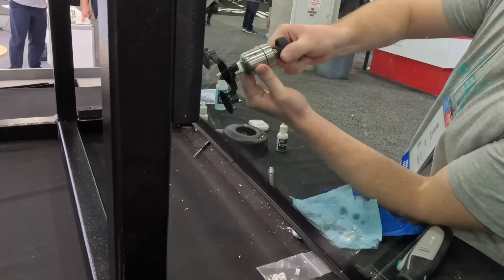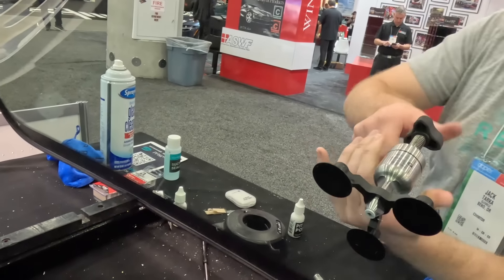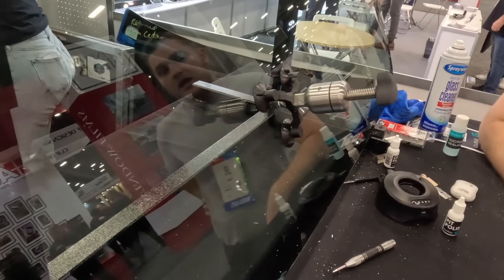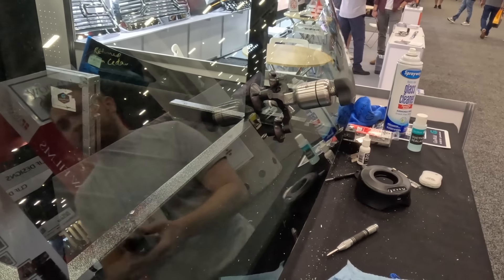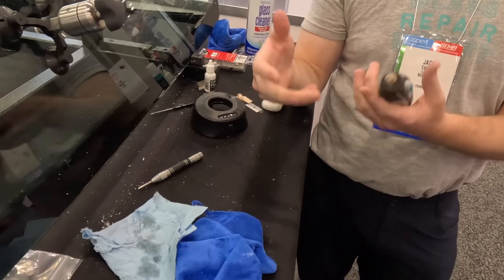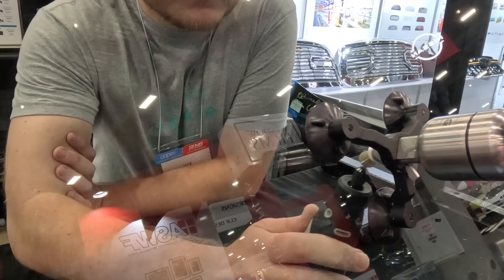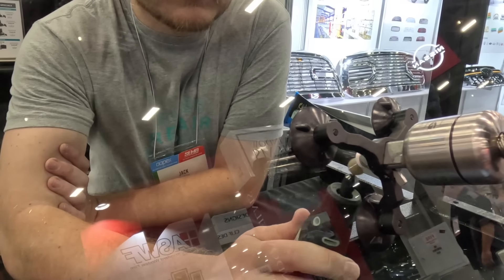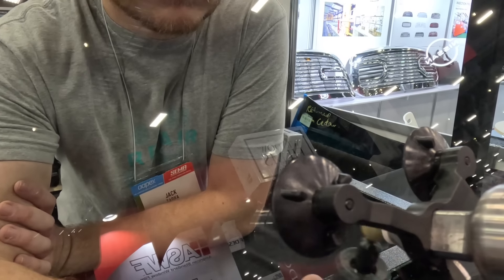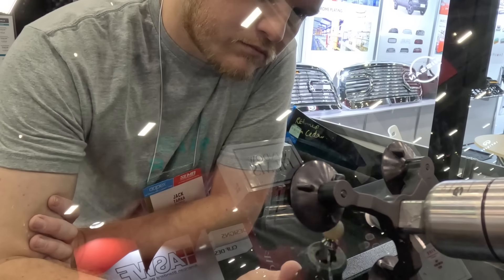The vacuum just goes all the way back. What's cool about these tools is it's pretty hands-off — just going through the cycles while waiting. There's no harm in letting it sit longer. With this Dremel tool and a polishing port, I'm going to take it on the inside of the glass and massage the break, which creates vibration — and the vibration is what's going to help that resin flow a lot. He's basically creating a frequency, a vibration that's allowing that resin to flow a little quicker and easier. You can see that one little leg starting to kind of disappear — it's definitely working. You could wait it out, but he's speeding up that process with the Dremel.